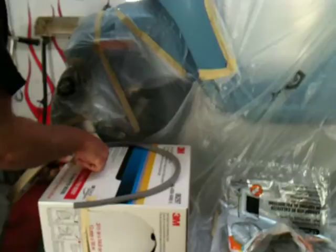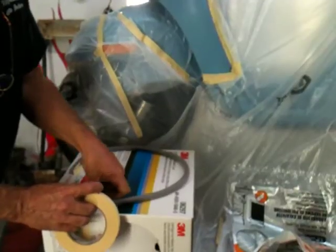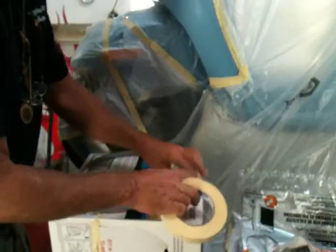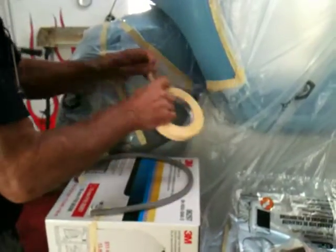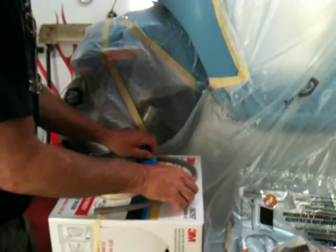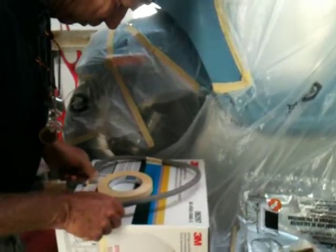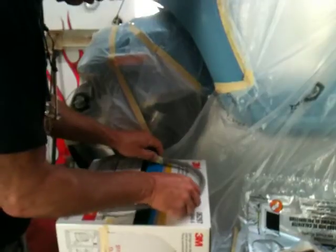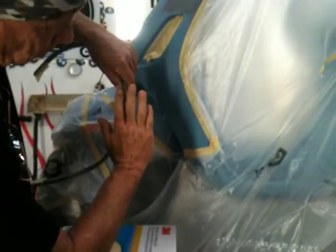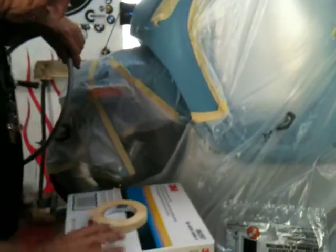First time is the best — I'm gonna put some little pieces of tape to help give me an outline and hold it up there. I'm more interested in helping those guys doing complete paint jobs. After you do your door jams, you want to put this inside a door jam so only that is peeking through and you won't get that hard edge. This is what the stuff is designed for — it's called door aperture tape.